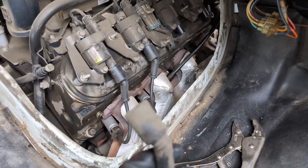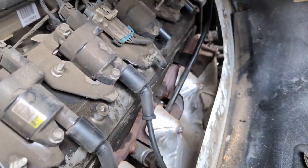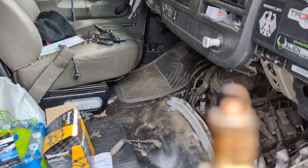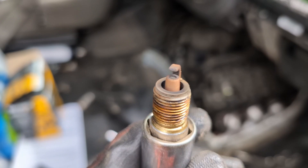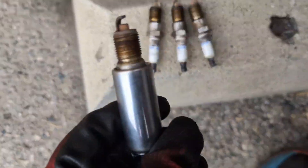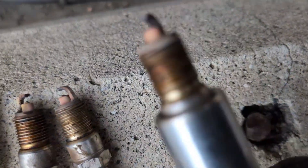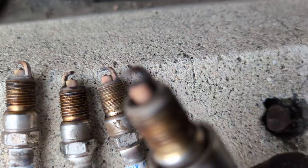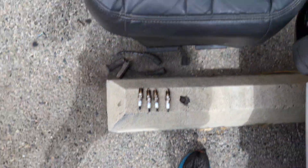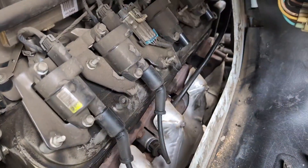I put the vice grips on the bottom boot for the fourth one in the back, and then just pulled — this one came off from the top because there's no space, it's actually touching the dipstick. This last one has pretty much no electrode left — wow. He's probably going to get way better performance. Look at that — one, two, three — the last one doesn't even have anything left. He probably would have had a misfire soon if not already.